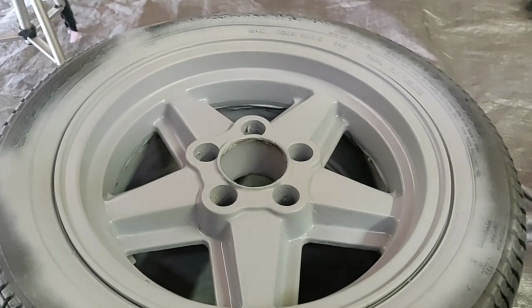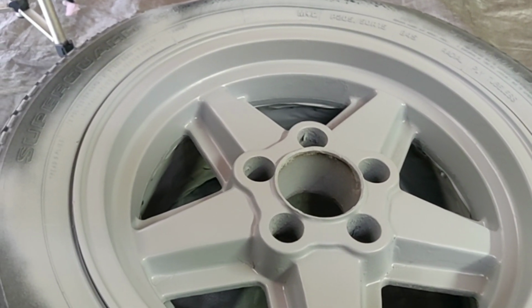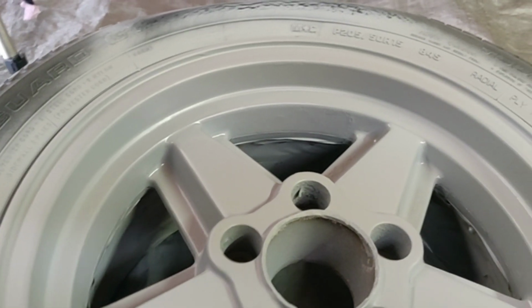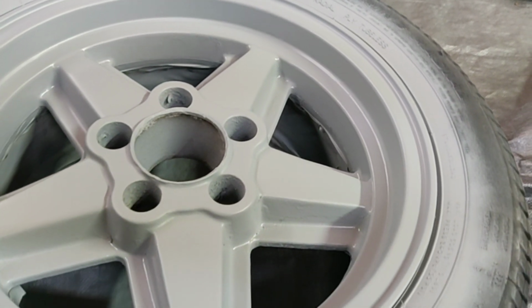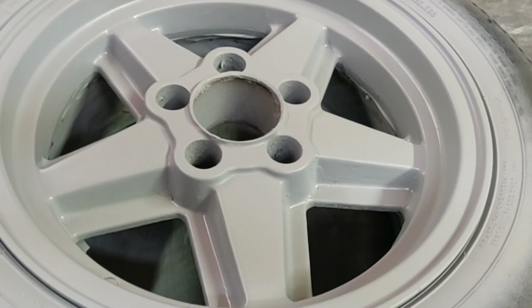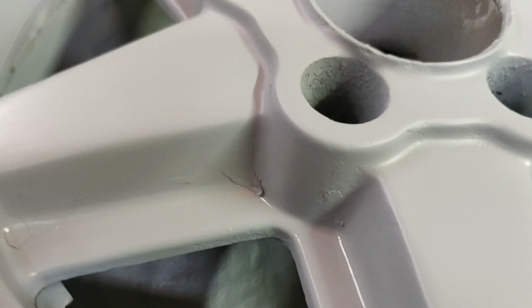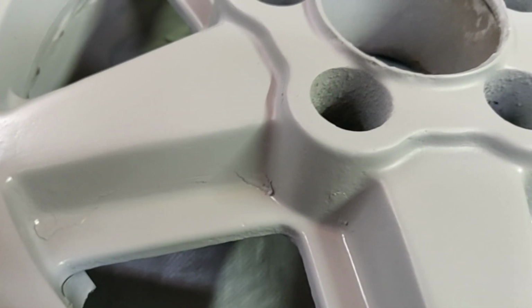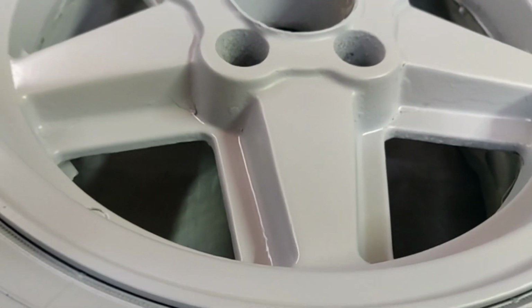So guys, you saw there, I put on a nice light thin coat on first, but hit almost every area, and then we hit it with a nice wet coat. Now, I'm going to give it about 30 minutes to dry before we start painting with our actual color, which is the Rust-Oleum Leather Brown. One thing that I did catch though, is if you look down here, there's a little area that started to curl up, and I'm not sure what caused that, so I'm going to scrape that up the best I can with a razor blade, and then re-hit that with our primer.